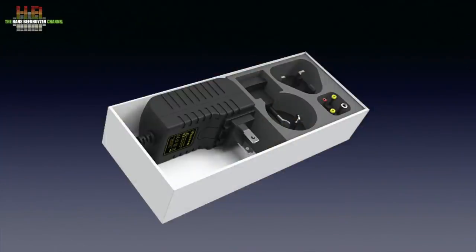If you want to use a 2.5-inch USB drive, make sure it's a low-power version, which most of them are nowadays. If such a drive doesn't work, it's likely due to higher power consumption. The 3.5-inch drives always have an external power supply that is often noisy. Using for instance an iFi iPower 12V DC power supply will in most cases improve sound quality — or rather deteriorate it less than the included supply. FAT, FAT32, exFAT and NTFS file formats are supported, although some reservations are noted in the manual concerning certain storage devices and memory cards.